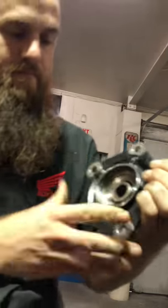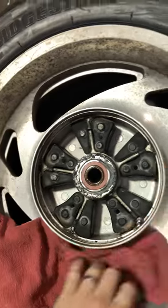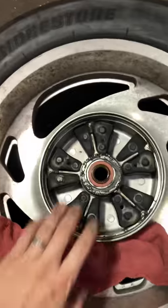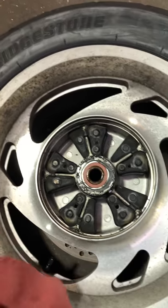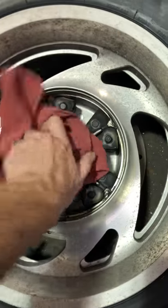Moving up inside of here with fresh grease is important. These are your little rubber pads for when you hit the throttle — torque hits the back of this plate where your shaft drive and final drive coupler are, and there's rubber cushioning there so you don't feel that instant jerk when you hit the throttle and the wheel's not ready yet but the engine is. You can get all this old grease off and put fresh grease all over it.